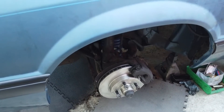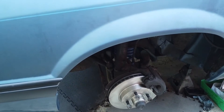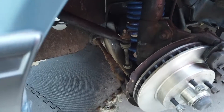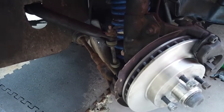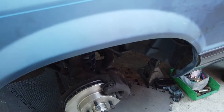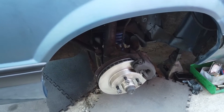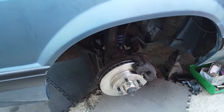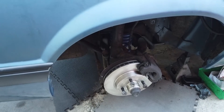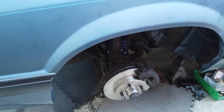I would have been done today but I still have to deal with these suspension issues - it's really been giving me the blues. The idea of reusing the tie rods - they'd been on there so long that when removing them, it got a burr on the threads and now they won't thread back on, keep spinning. And the ball joint and the tie rods are both jacked up. I'll be honest, I'm out of money, so I'm just gonna wait until I get back on the saddle and replace them. What's the point of doing all this work and then smacking it into a tree because a wheel fell off?